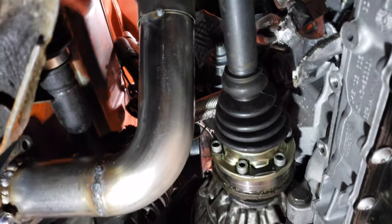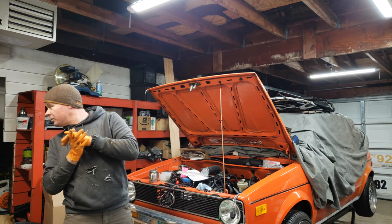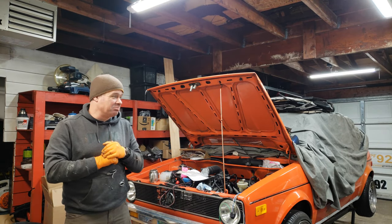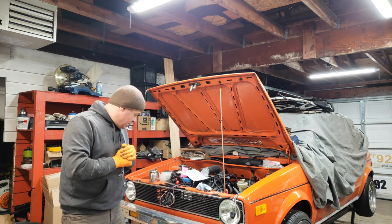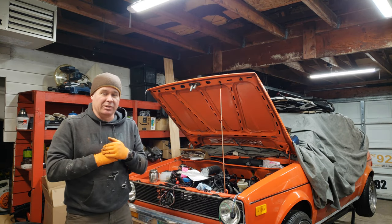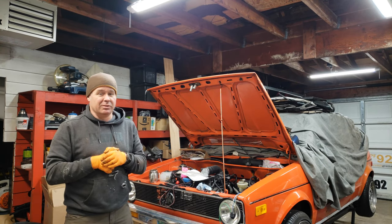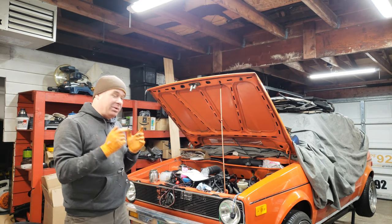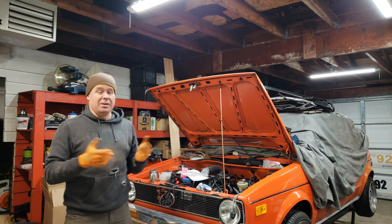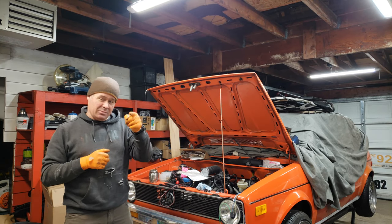There are probably some things I could do better, but that's all I'm doing today. I'm tired — I've been out in the garage all day. It's almost 50 degrees in the garage. Unfortunately I won't video the rest of it, like the welding table work or putting in the oxygen sensor bungs — that's just drilling a hole and welding the bung over the top, nothing too cosmic about that. But that's one more thing off the list on the Rabbit while I'm waiting for parts for the Mitsubishi. All in all, a pretty productive day. Until next time, get out there and work on something.